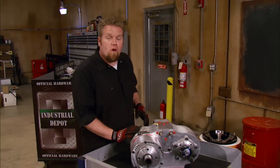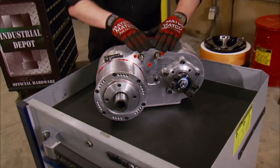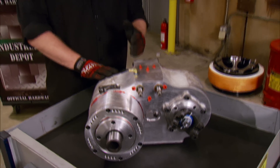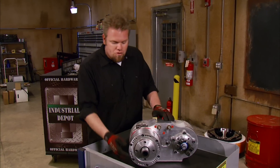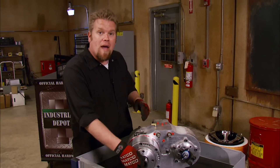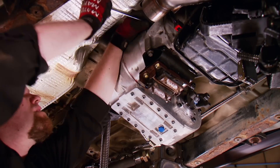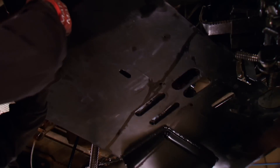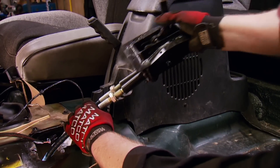We're not just installing small parts today — we're also bolting in some major components, like this four-speed transfer case from Advance Adapters. Advance took their tried-and-true Atlas II transfer case and coupled a secondary reduction box onto the front of it. This is the first-ever crate four-speed case available, with four ratios: 1-to-1, 2-to-1, 2.72-to-1, and 5.4-to-1. The case is rated to accept up to 5,500 foot-pounds of input torque and can handle vehicles in excess of 11,000 pounds. The Atlas bolts right up to the automatic that came with our Hemi, and the indexing ring lets us fine-tune the case drop. All Atlas units come with a lifetime warranty — just another item we know won't let us down on the trail. The shifters mount under the stock console and use cables to control the shifting.